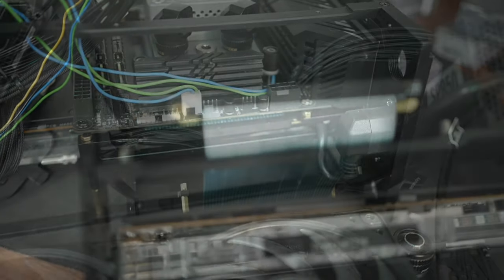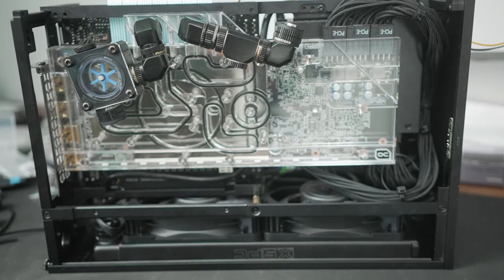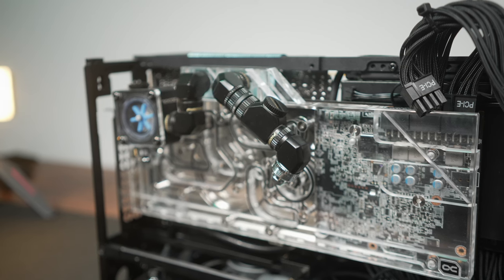With all the space on the GPU side, I thought I could shift the riser cable and put the GPU at the outermost position so I could run the fittings on the inside in the middle of the case. But that didn't end up working after I shifted the motherboard divider back inward. So I moved the riser cable back to the innermost position, which gives a comfortable amount of room for your typical block with fittings at the top. For most users, that innermost position is going to be the safest bet.